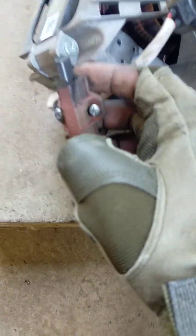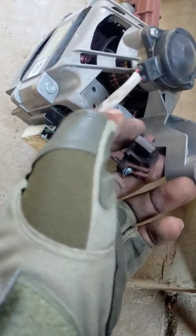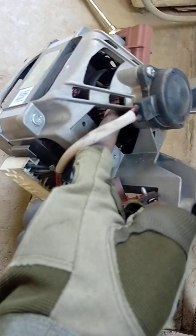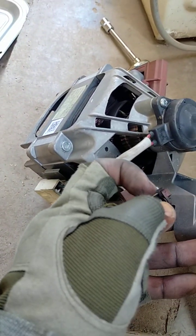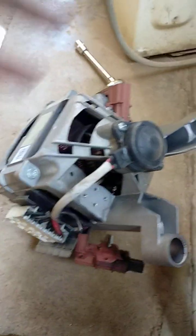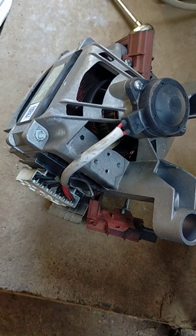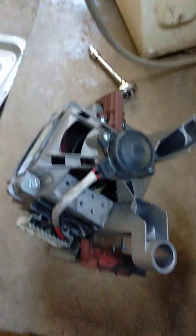They are quite short, but the machine should still work. When you see the machine sparking, this metallic piece here touches the armature. When the armature is running and touching this metallic piece, it starts sparking and can easily blow up the motor. So don't use a machine that has worn out brushes, because you will end up replacing the motor, or the motor and the control panel.